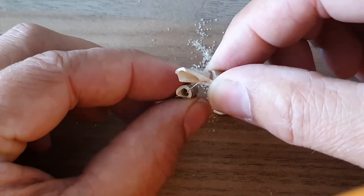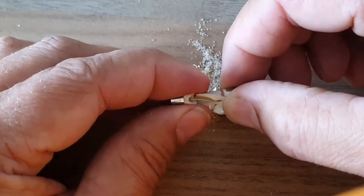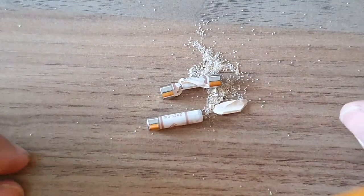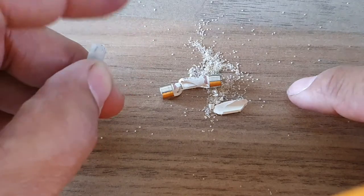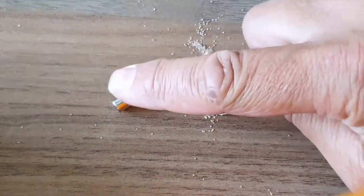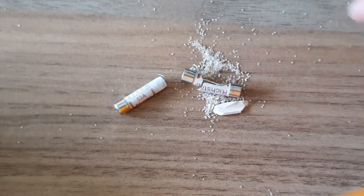A fake fuse can cause a fire, not work at all, or make the cable overheat — which is itself a fire hazard. Fuses are a safety device to protect the cord and ultimately the end user. They've gone to all that trouble just to save money by putting this fake thing in with caps on the end. This is an original fuse — it's got all the markings. The fuse wire is actually welded to the caps inside, so you can't pull them off. Opening one up, you can see all the silica sand in there — that's the difference.